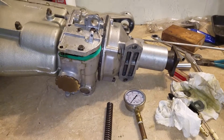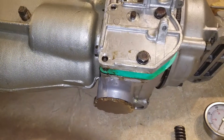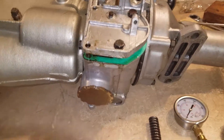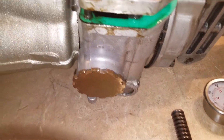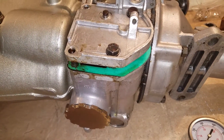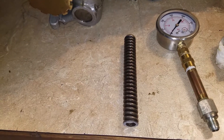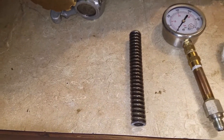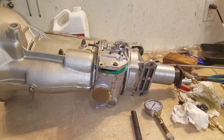There's one other thing I was wanting to ask you guys who are watching: this is an early A-type, it's a large piston A-type, it's a 1374 I think. You can't see the large piston spring now because I've got that in there holding the piston down, but that spring is six and a half inches long, which is what Moss sells for their large spring. But this spring is only five and a half inches - Moss shows their small spring at six and a quarter. Does anybody out there with an early A-type know that their springs were that much different in size? If you do, let me know.